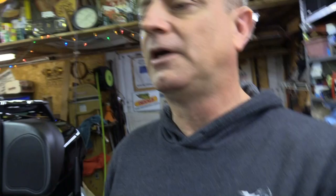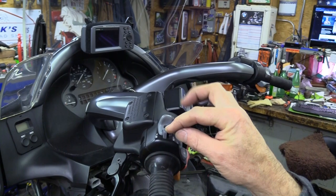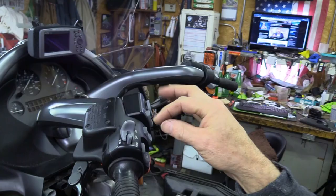So I hope that helps some of you guys out there. Hopefully you can get your cruise control working again. Make sure to test it out — I know there's a way to also test it at the handlebar. Obviously you can't fully test it until you're riding somewhere, but if you hold the cruise control on and turn the key on at the same time, it will light up here and you'll be able to see if that's working, and then you can test to see if your micro switches are working as well.